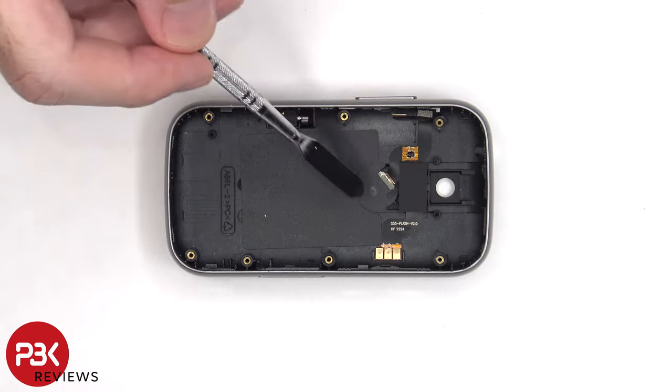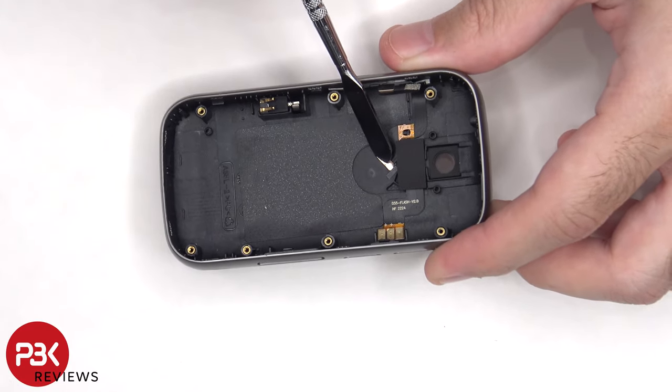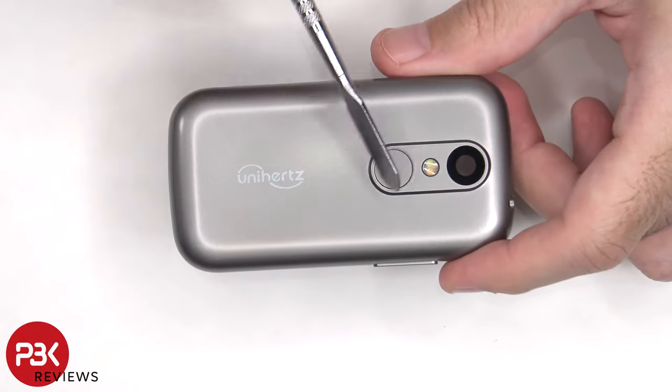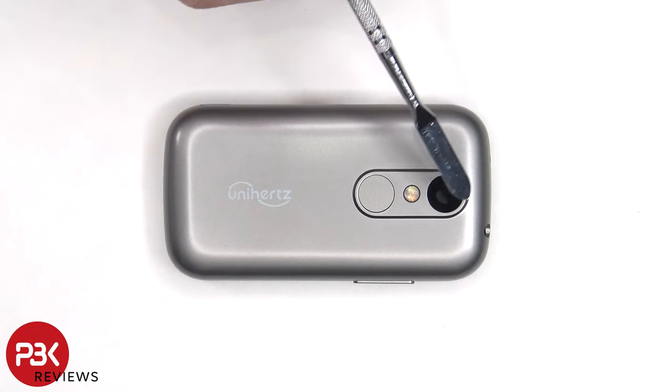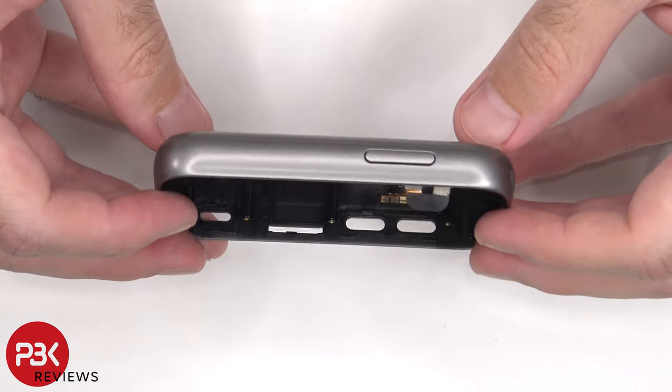This flex cable is for the fingerprint reader. So if you needed to replace the fingerprint reader, you'd gently heat up this area and push out on the fingerprint reader from the back, prying it off from the housing. The camera lens cover itself is held down with some adhesive, so if you needed to replace that you could just heat it up and pry it off — you wouldn't have to disassemble the phone. The back housing itself is made of some strong plastic.